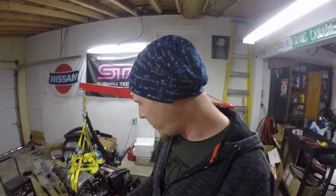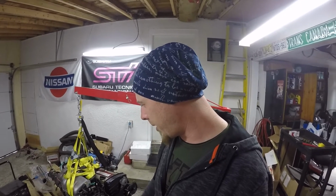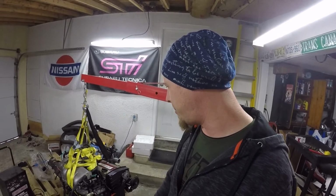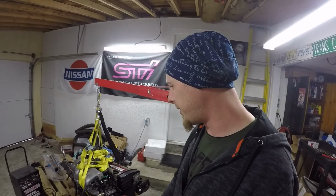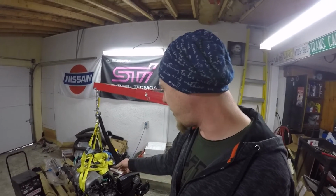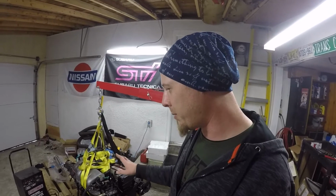There is like one or two black wires that I'm kind of wondering if they're grounds or not. I haven't been able to trace them anywhere. So anything like that could be the issue. Not having a mass airflow sensor could be an issue. But I'll pop the ignition cover over, and I'll get it to the next point for the next video.